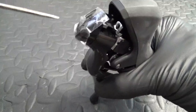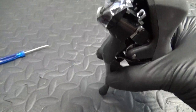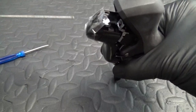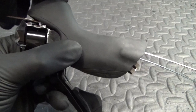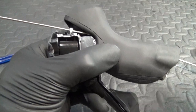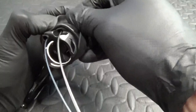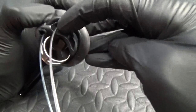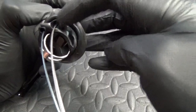To install the brake cable, depress the lever slightly and you can see the cable is going to go in that hole there. Get your end of the cable, keep the lever depressed so you can get it in. Keep it depressed slightly so it's not pinching the cable, and just push it through. It comes out the back — keep pulling it through until you see the stop on the end. Make sure the stop goes in there, then let go of the lever. That's the brake cable installed. There's no end piece on the brake cable — the outer cable itself just comes around and goes straight up into the slot in the hole there, unlike the shift cable.